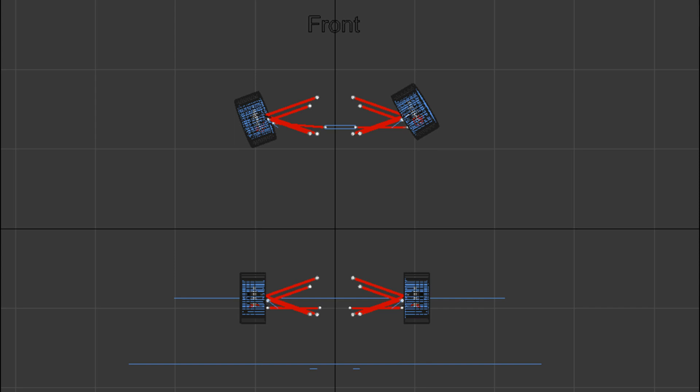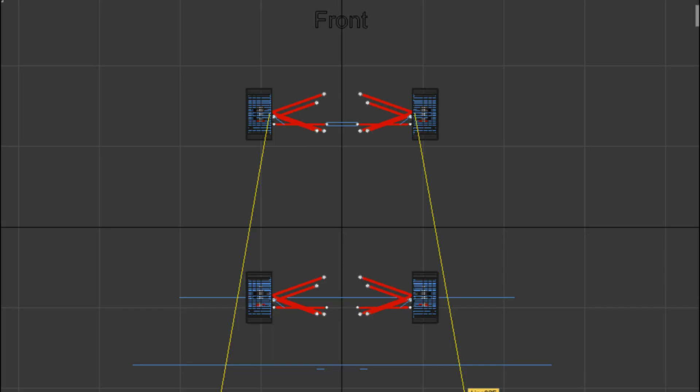These settings can only be optimized for certain types of corners, which is why some racing teams actually change their suspension settings when going from one track to another. Production cars stay away from anything like this because they don't want their tires scrubbing every time you take a corner. But for cars specific to the track, you'll find geometries where they change the Ackerman in order to optimize slip angles and get more grip. Anyway, that's everything for this video — the E55 videos should be coming up in about a month from now. Thanks for watching.